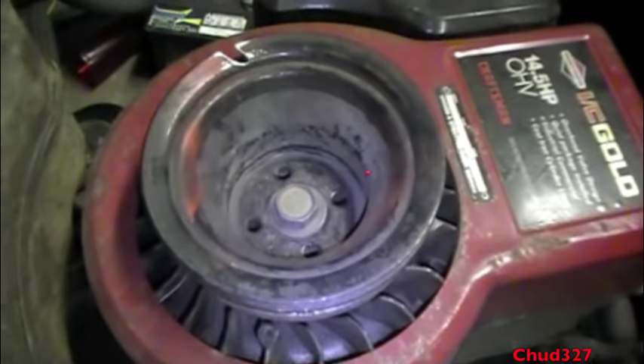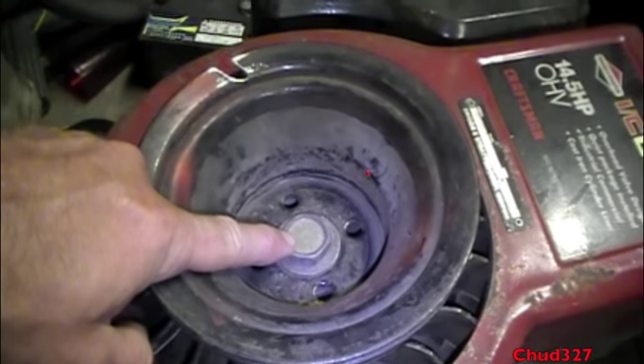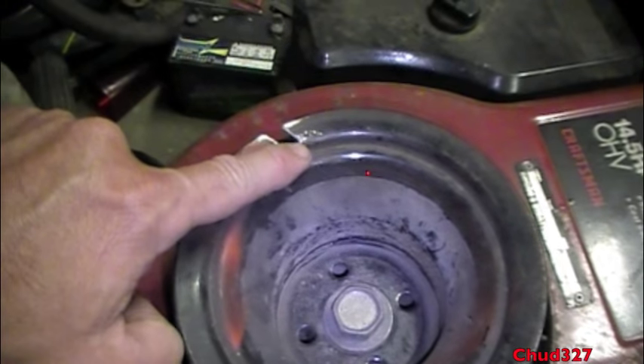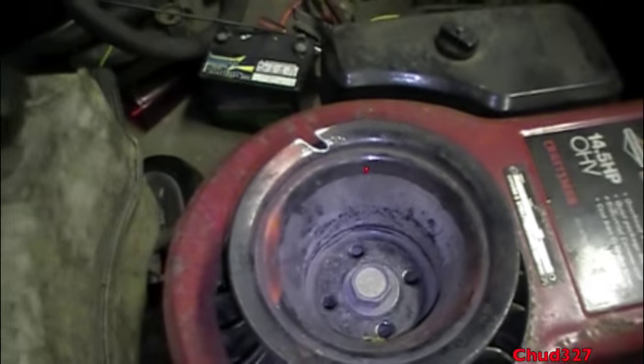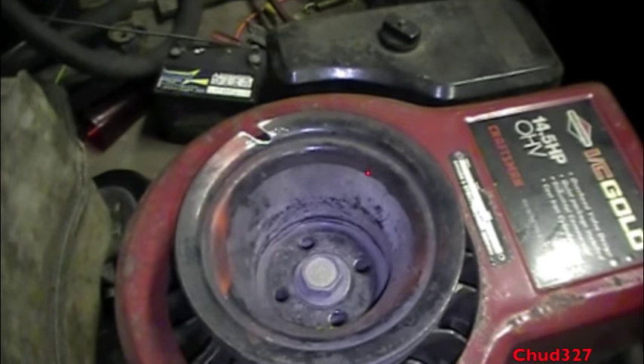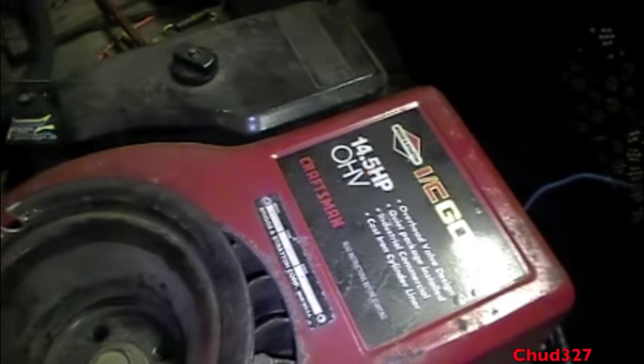This pull rope pulley literally took about five minutes. Took this bolt out, put the bolt back in, made it tight, took the grinder, made this little notch, took the file, smoothed it out a little bit, wrapped the rope around — and in one pull, cold start, choke on, fired right up. Even though it's a 14.5 horse. Good deal.